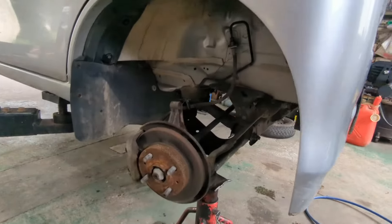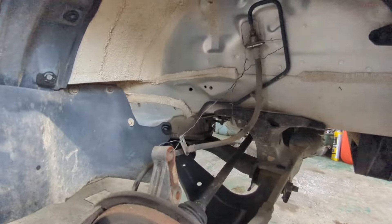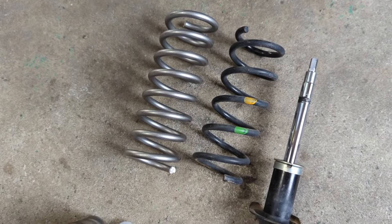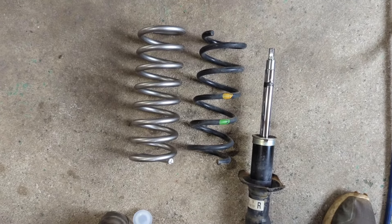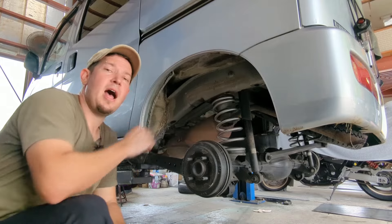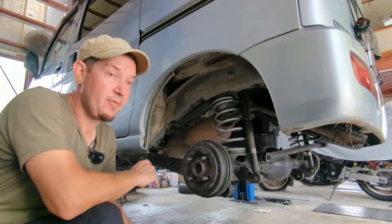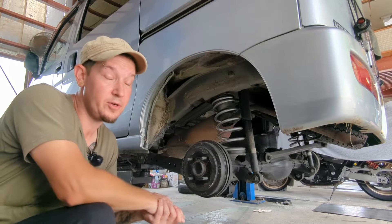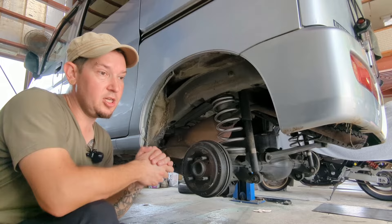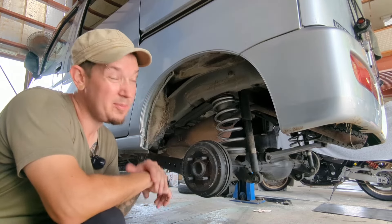The stock springs from the front are off, everything's cleaned up inside, and he says it's all looking hunky-dory. The circumference of each new spring is about the same as the stock unit, but the height of the aftermarket unit in the front is a fuzz taller — again, not a massive lift, just a bit of one. Another reason I went with Forest Auto Factory is not just their great reviews and years of supporting the Daihatsu community, or their Tokyo Auto Salon Grand Prix win — it's because these springs are still made in Japan out of Japanese steel.